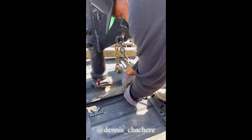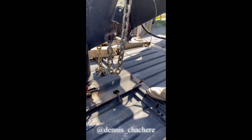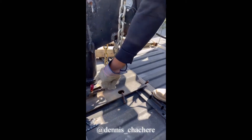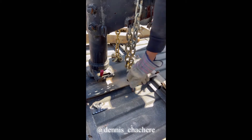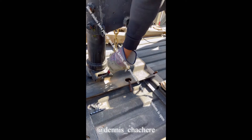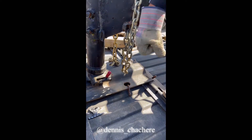You're going to do your emergency chain — you want to do this one on the side. You got your levers on to lock your pin in point. This right here is the lever. This is locked and this is open. When you want to unhook, always move it to open, and this will release it from hooking onto your ball, your gooseneck ball.